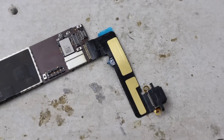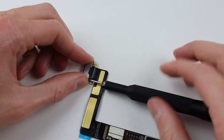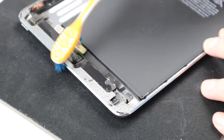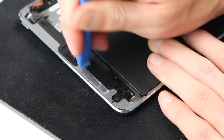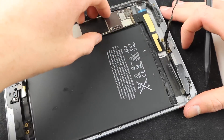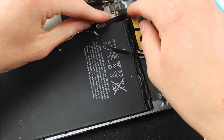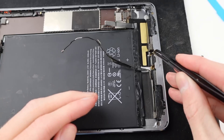Now that I know everything is functioning, I can use some cleaning alcohol to clean off any flux or solder residue on the parts we just soldered. Connecting up the surround and screwing it into place, I can move along to the new iPad housing and clean up all of the old adhesive left behind from the old screen. The iPad logic board that was in the donor housing is completely dead — it showed no signs of life and probably has something wrong with the power management chip. I'll try to repair that in another video, but for now I'm using this working logic board to bring this iPad housing back into functional order. I can then install the new logic board, stick down the dock connector, and start to reassemble the speakers, which had to be removed to fit the dock connector back into the frame.